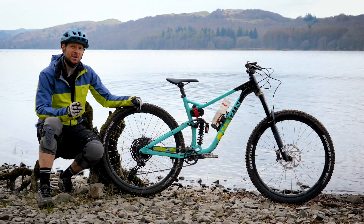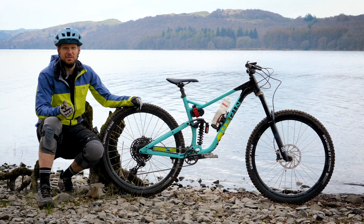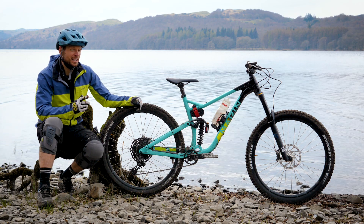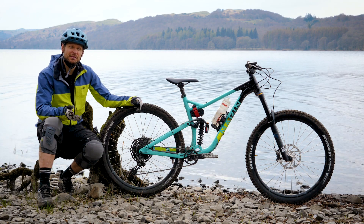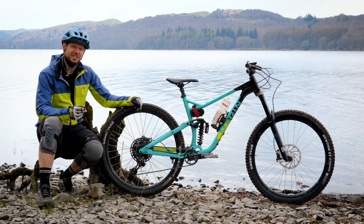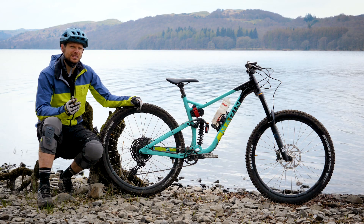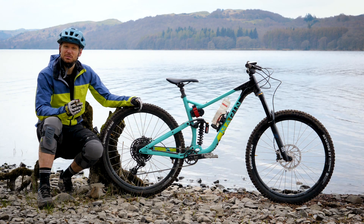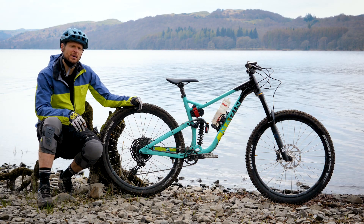What would I change? The Alpine Trail has got it pretty dialed, but I wouldn't mind seeing it a little bit longer — for riders six foot to six foot four and above, going over the 500mm reach mark would be good. The head tube is reasonably short, so on my bike I'm running quite a few spacers, and lifting the bars does reduce my reach slightly. I'd also consider extending the chainstays just a little bit — those short chainstays provide a ton of fun, but in terms of front-to-rear wheel balance, a little longer wouldn't go amiss. Finally, the seat tube angle is already pretty steep, but I think there's still room to go a touch steeper to keep you really forward on the steepest climbs.